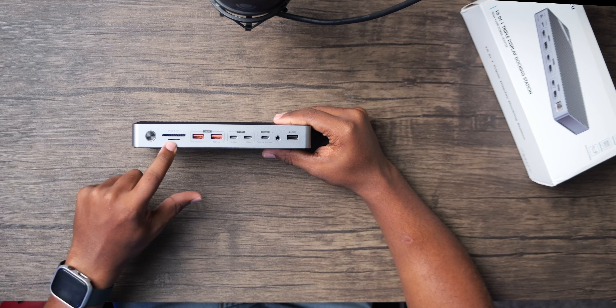You've got two 10-gigabit USB-C ports on the front, as well as what they're claiming is another 10-gigabit USB-C port with 30 watts of charge power. This gets its power independently, so it's not drawing power from your MacBook. It can charge your MacBook and then offer an additional 30 watts. One thing that's interesting — this adds up to 50 gigabits here. If my math is correct, you've got four 10-gigabit connections: two flavors of USB-C and two flavors of USB-A, and then an additional 10-gigabit USB-C. But this runs on only one USB-C port at Thunderbolt speeds, which maxes out at 40 gigabits, so we will not be able to run all five of these ports simultaneously.